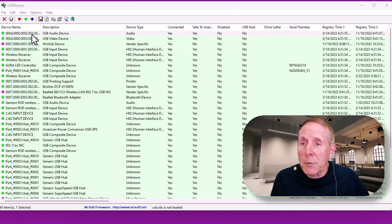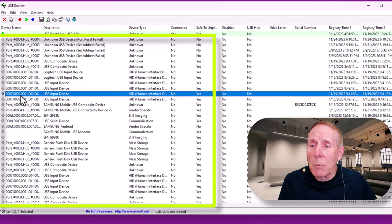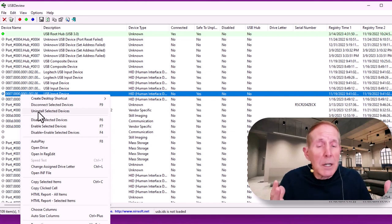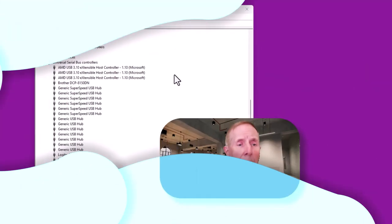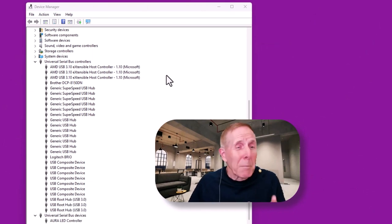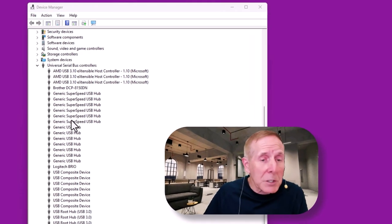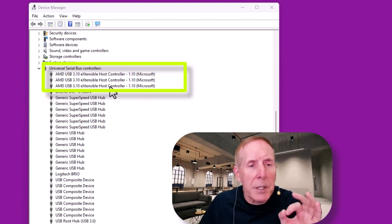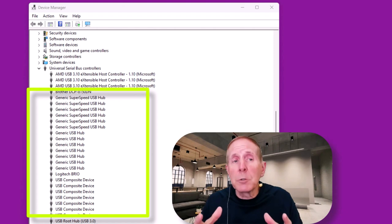This utility is not going to solve everybody's problems, but for example, if you go to options, you can display disconnected devices and uninstall any of them — it removes them from your registry and takes out any added drivers. It's a portable app and a tool worth your time. Device Manager is also super helpful in solving USB problems, but often when I find conflicting or failed drivers in USB Device Manager, I go back to Nirsoft, find that device, uninstall it, try reinstalling it, and many times it goes in fine. When you're looking at Device Manager and you see the host controller, those are the actual chips on your motherboard. Drivers are a common problem with USB — Microsoft delivers a large majority of the drivers we use in our USB stack.